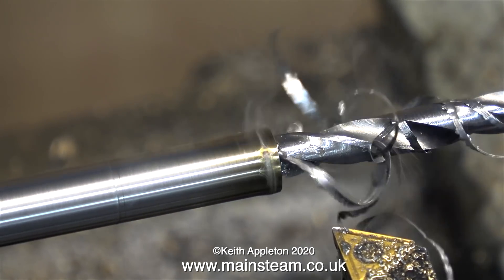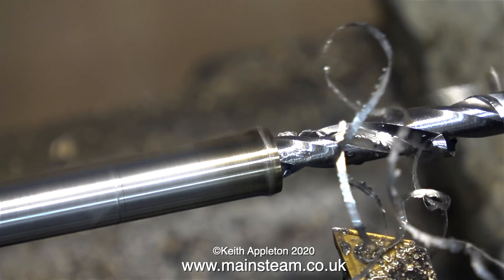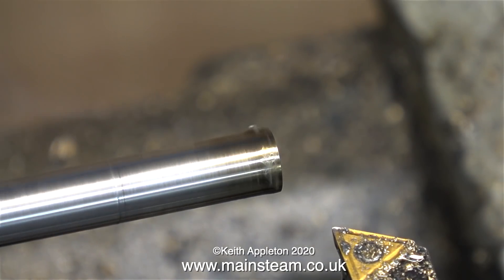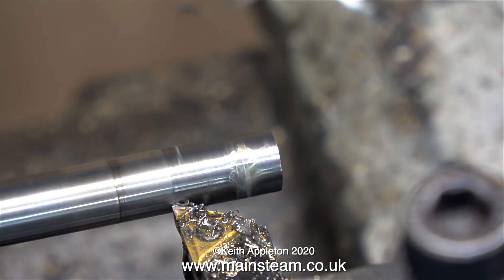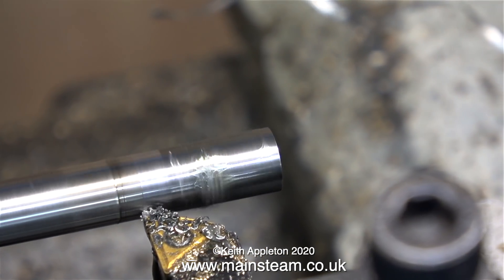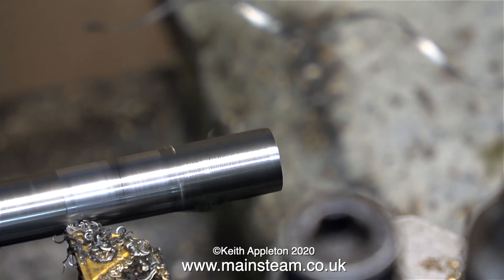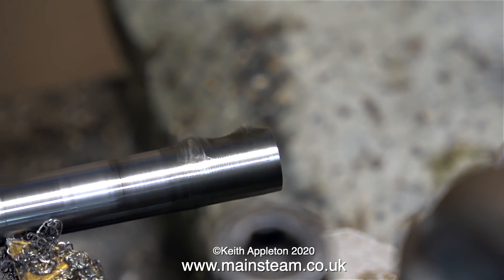You can see a couple of things from this clip: the twist drill is still getting very hot, but it's going into the work okay. The piece of bar, which is a long way out from the chuck, is not 100% true, but this is not a problem — it isn't a high-precision part, it's only a handle for a water pump. A very fine cut should get rid of the mark in the centre — yes, I think it's more or less done.